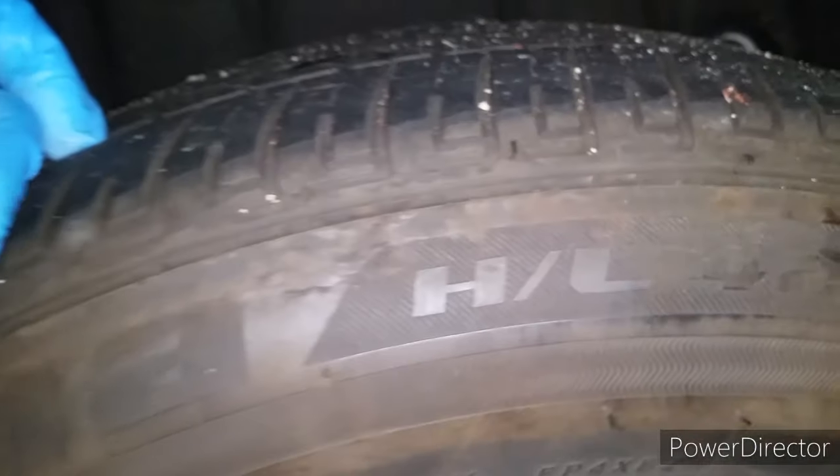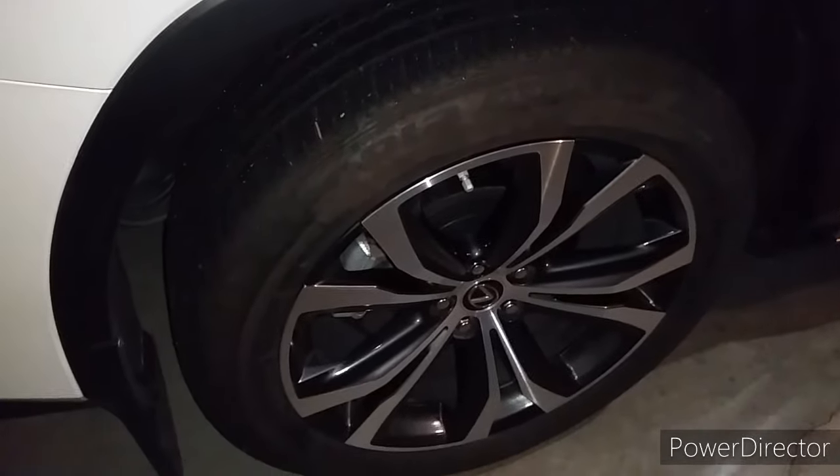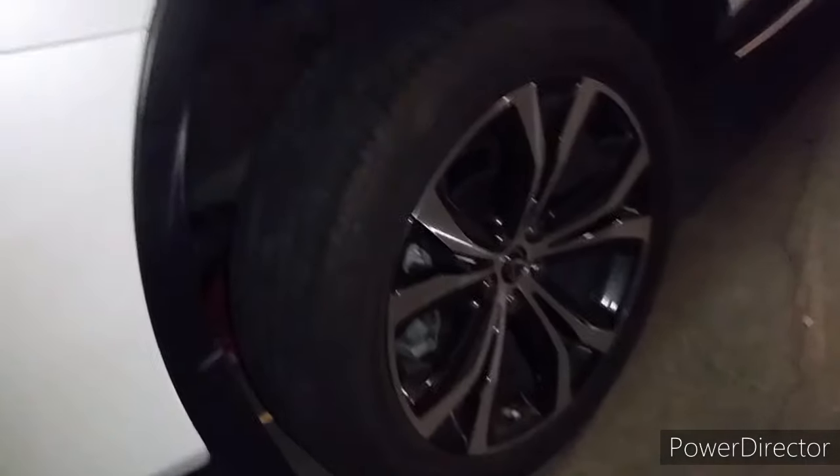As you can see the tires are still good — we've got some good tread on them — but this tire does not hold air anymore. It was damaged by a nail going through the sidewall. Not only one hole, it produced two: when the tire gets mushed, it poked another hole.